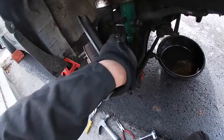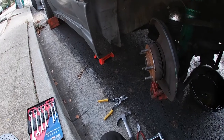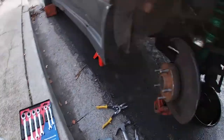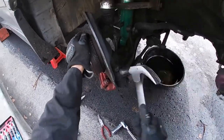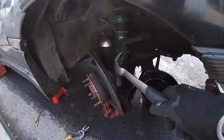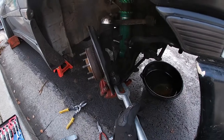I don't know if I ever showed you guys this trick to take out tie rod ends, but if you can see - I got the acorn nut or the crown nut just barely over the tip of the tie rod end, just a little bit over it, just like how this is right here. Then you want to get a hammer and smack right here on the side of it. Sometimes they pop out. If they don't, just smack it once or twice pretty good on the top of it. You have to be careful because you will damage the castle nut.